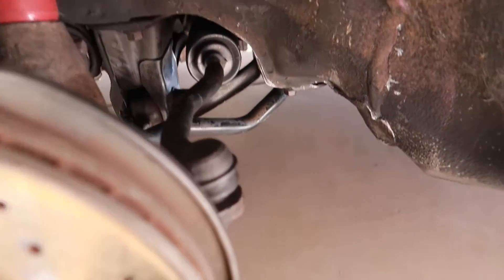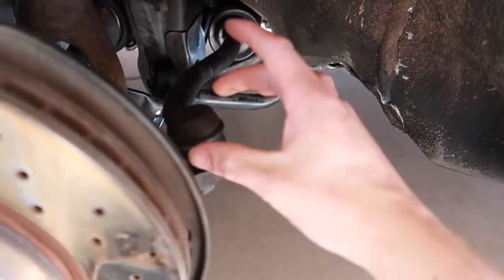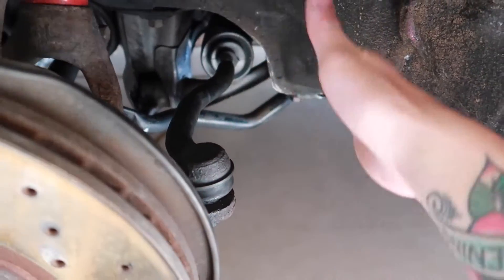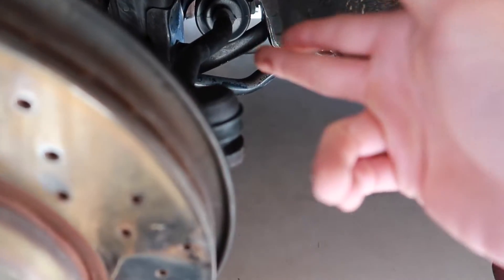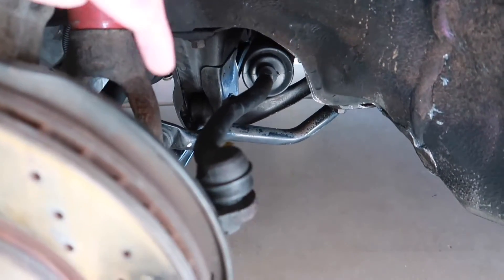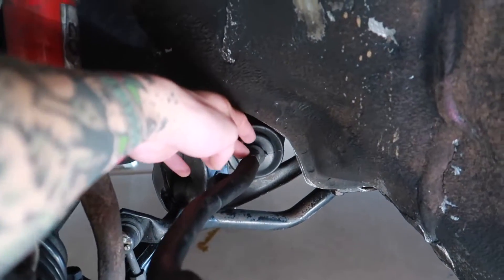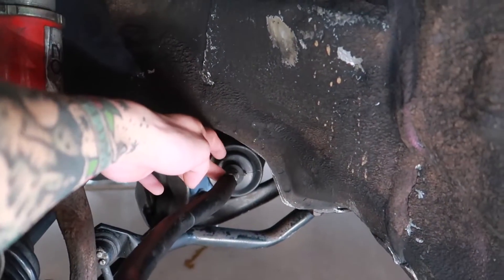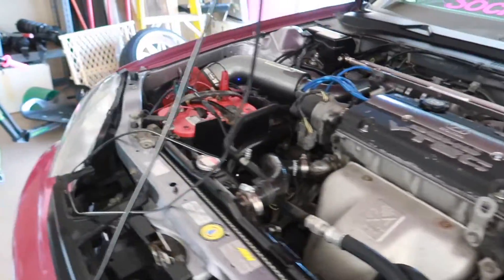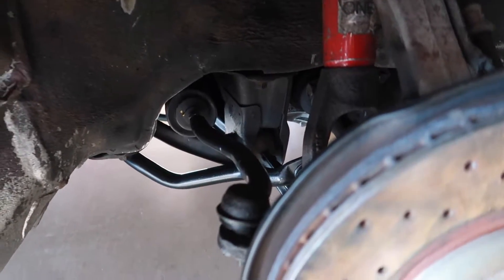What we're going to do is take off this locking nut, disassemble the outer tie rod from the knuckle, and count the revolutions outward - which I believe was 14. We'll do that for the passenger side too. When we install our new outer tie rods, we'll throw the locking nut in the middle of the inner tie rod thread and screw in 14 revolutions. For this side we just had to screw the outer tie rod in about 13 revolutions.